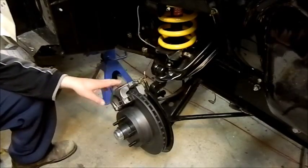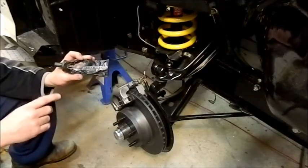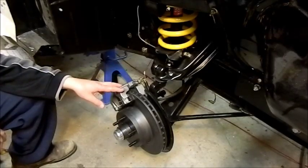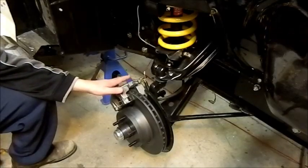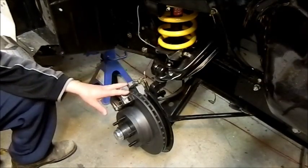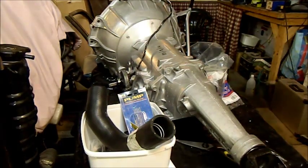Just a quick note about these brakes - it was called into question how I overhauled them using PBR rubber grease, which is a castor oil base rubber grease. A lot of people have the opinion you have to use brake fluid, and you can indeed use brake fluid - I've done it a couple of times and find it's a sticky pain in the neck, making the pistons very difficult to get in. Using G-clamps or multi-grips to push pistons back is an absolute no-no. Vice grips are fine for pushing a piston back with pad changes, but when putting the piston in for the first time you should be able to push them in by hand - if you can't, something's very wrong. I've conferred with other senior mechanics and they agree.